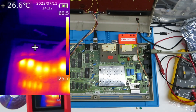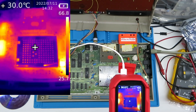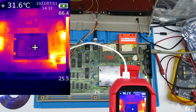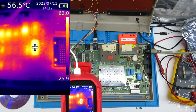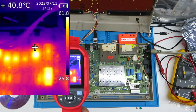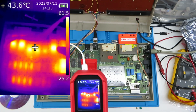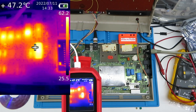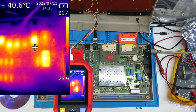I'll overlay some of this into the video. The VIC here is running at about 30 degrees, whereas the SID chip over here is at 50 to 56 degrees. The CPU is about the same but heat is localized to the middle of the chip. The SID — the whole case is conducting heat. This is telling me the SID is a little bit warm and could do with a heat sink.